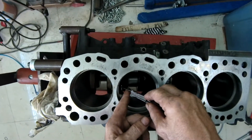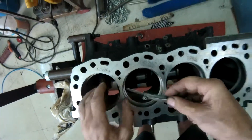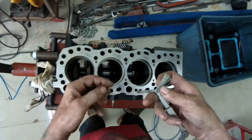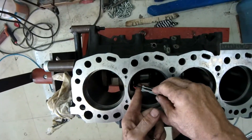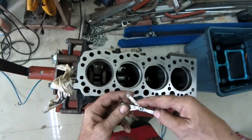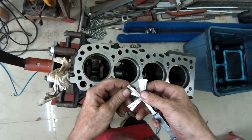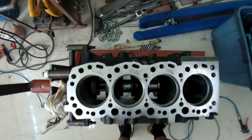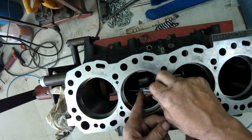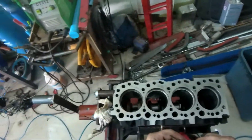Right, let's go for the top ring. The top ring is definitely less. 0.5 — oh that's snug. It's a little bit more than that, so... 22, 24, 25 thou. Let's go for 0.6 of a millimeter — and that is it, 0.6. For some reason the second ring is quite huge.